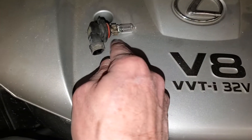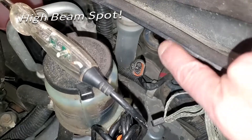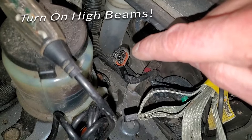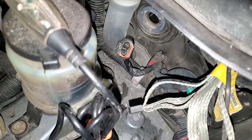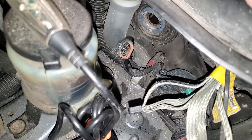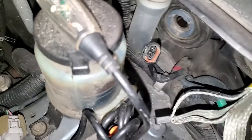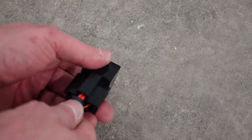Here's what I did: I popped the bulb out of the headlight socket and you can see where it came out. I used a little test light, grounded it, and checked the two terminals — one is hot and one is ground. You don't want the hot one. High beams and low beams always have power on them, so if you tap that hot wire, your lights are going to be on all the time. You want to tap the ground wire, because when that ground connects, that's when the lights work. I found that the top terminal is hot, so I'm going to use the bottom one.